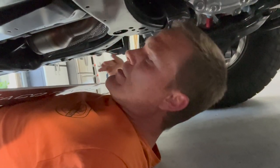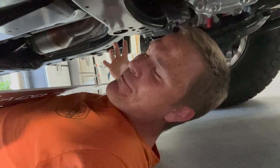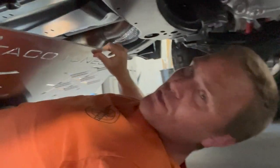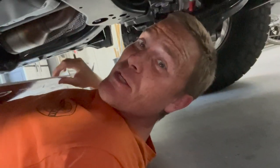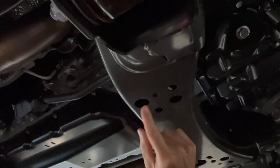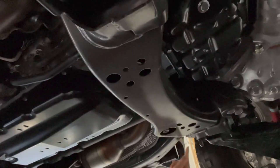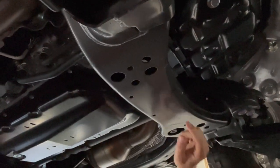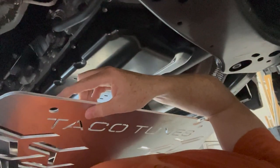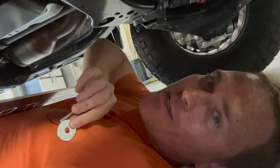So I shimmied myself under the truck. I have the plate laying on me — not that heavy. You can use other ways, other methods to do it, but I think the plate's only like 18 pounds because it's aluminum. The Taco Tunes emblem is going to be closest to you. And then we are looking at this cross member right here, and you can see that there's three holes right here. This one is threaded, and same on this other side over here. So you're going to line up the hole of the Taco Tunes plate with this threaded hole here, and one of the short bolts threaded in.